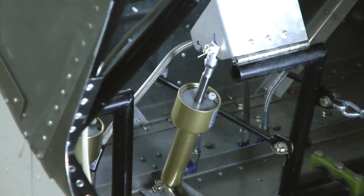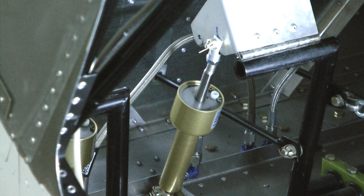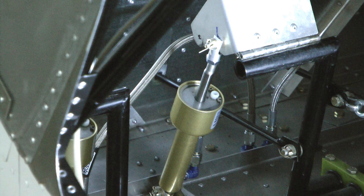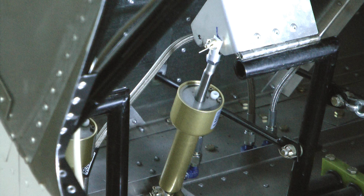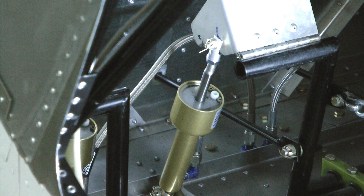To fill the system, we simply start pumping our squirt can until the fluid travels all the way up to the master cylinder and starts filling the reservoir. When brake fluid starts oozing from the vent, we know that the reservoir is more than filled and we are done. The bleeder valve at the caliper is closed and the squirt can removed. If our brake pedals provide a solid feel when pressed, our operation is a success. If in the future you need to disconnect a brake line to perform maintenance or parts replacement, remember that by injecting the fluid from the lowest point, you drive any air upwards to the reservoir where it can be expelled into the open air.